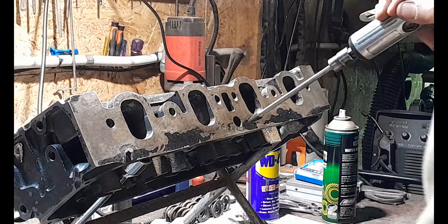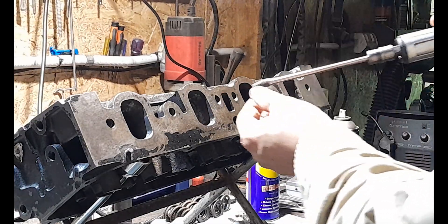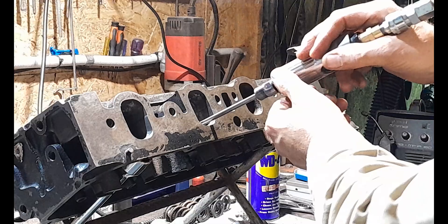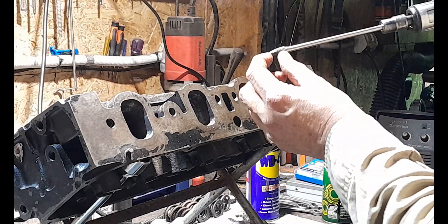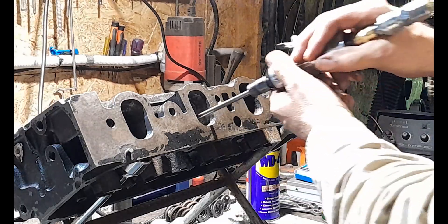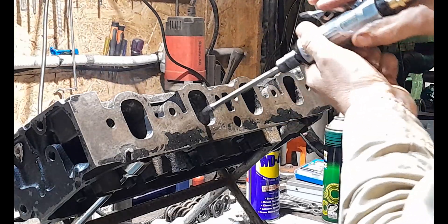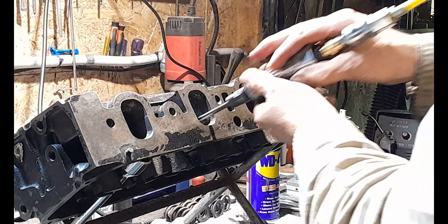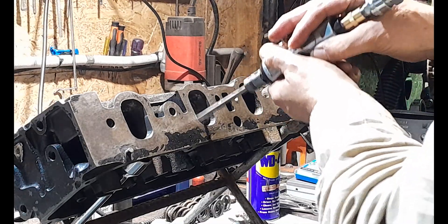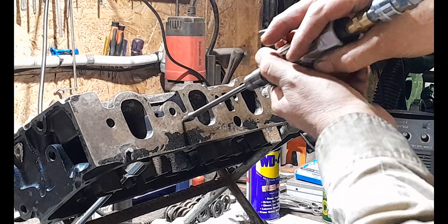As far as technique goes with running the carbide, that can depend. You can do nice slow strokes with the carbide, and again this all comes down to what you're using. Being a tapered, narrower carbide, these are very handy for getting in next to those valve guide bosses. Because they've got a longer taper they've got a bit more area to work with. Obviously you've got to angle your shank to pick up the entire length of your carbide. I generally move my carbide pretty quickly. As you can see, that sort of motion is how I use it — it depends on where I am in the port and what I'm working on, whether I do fast sweeping movements or a slower groove technique. When I come around the entry here into the intake I'll take it a little bit slower so I don't end up grinding across the face of my intake.